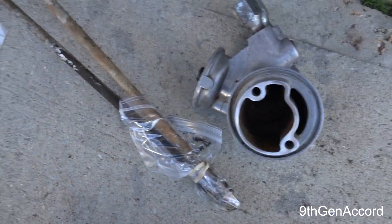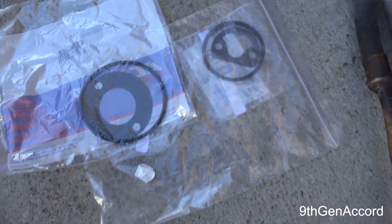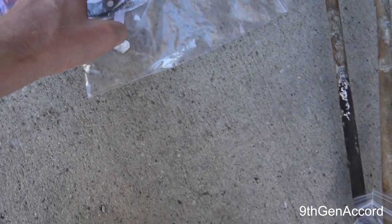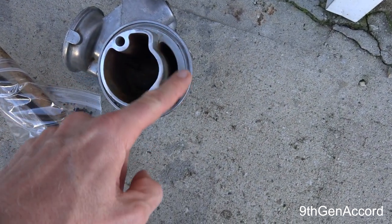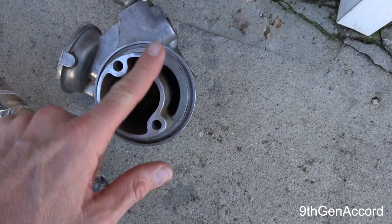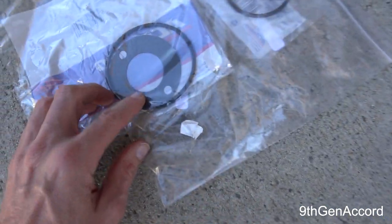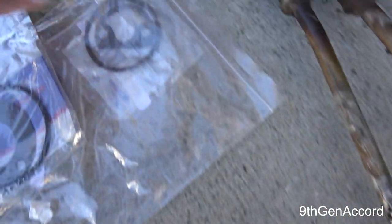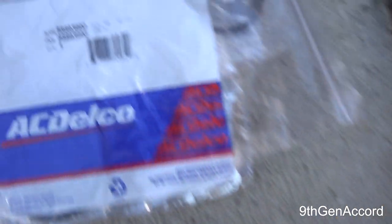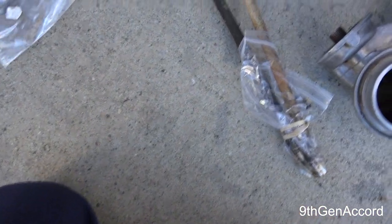This is the correct gasket — see the size difference. This round gasket is metal with fiber and fits right here. That is the correct gasket. The O-ring fits in the O-ring channel right here. So you can see the difference. That is the part number that fits the V8 engines — the 5.0 and the 5.7.